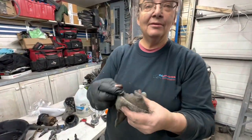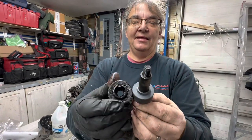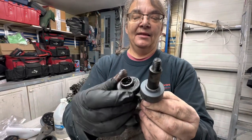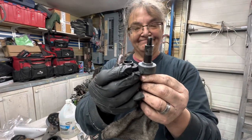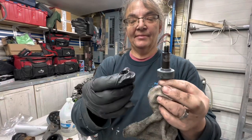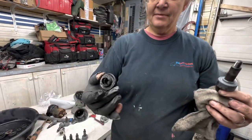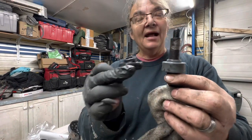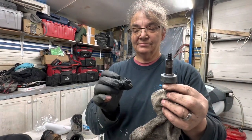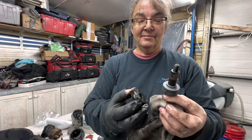Not good, good. New. So these rubber bushings are what hold on the oil pan. You can see they're not in very good shape. One of the reasons the oil pan was leaking, the other obviously the silicone on the seal. If you look at some of these, how flattened and broken they are, not good at all. Again, there's the question of torque. Yeah, and these are torqued. These have a torque specification as well, 28 foot-pounds in our case. But it's designed to maintain that torque.